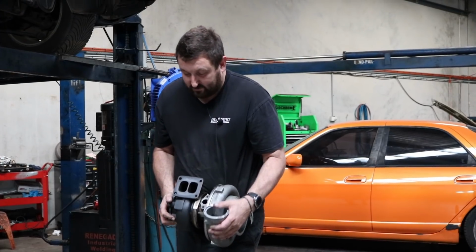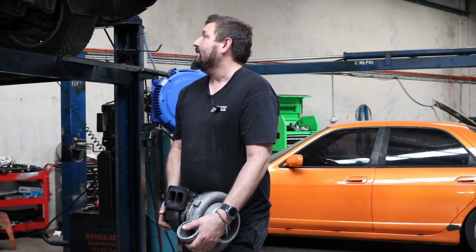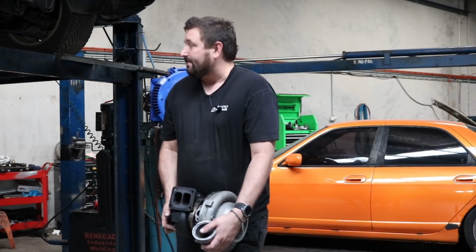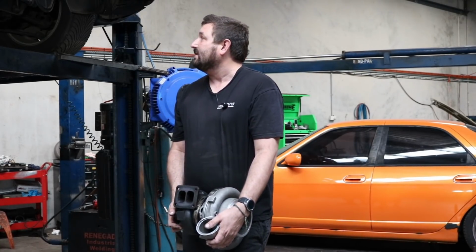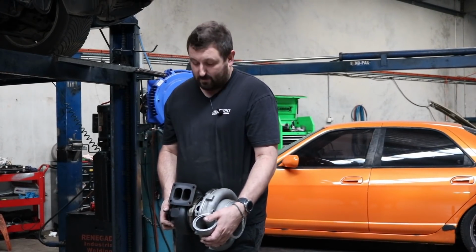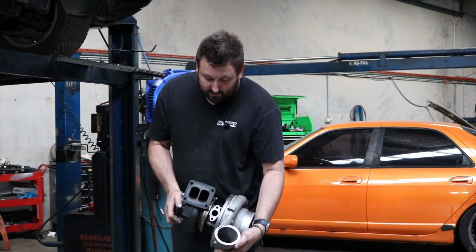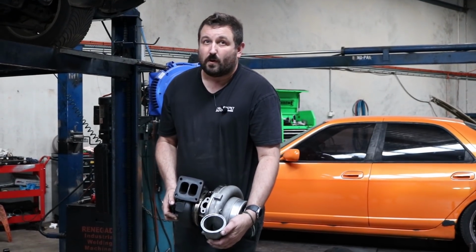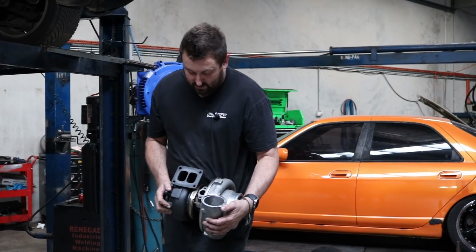We've got a 4-litre engine, even though the turbo's 3.5 metres back from the engine. Most people tell me that on an LS-style motor you've got to have no more than a 3-inch feed pipe between the engine and the turbo, single. So we're going to try and do twin 2-inch, which I think works out about the same as 2 3/4, as far as volume goes.